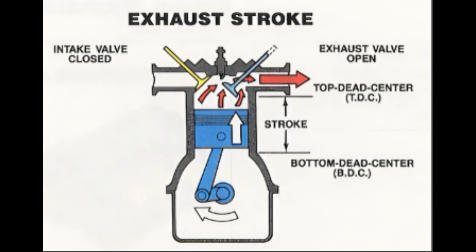It's also important — and I'm sure a lot of people don't think about this — the intake charge size and the exhaust charge is pretty much fixed to the size of the cylinder. People tend to think about the size of the motor, but a 1000cc bike that's a two-cylinder has far different exhaust pipe size needs than a four-cylinder. The two-cylinder obviously has each cylinder larger, so each exhaust pulse would be larger.